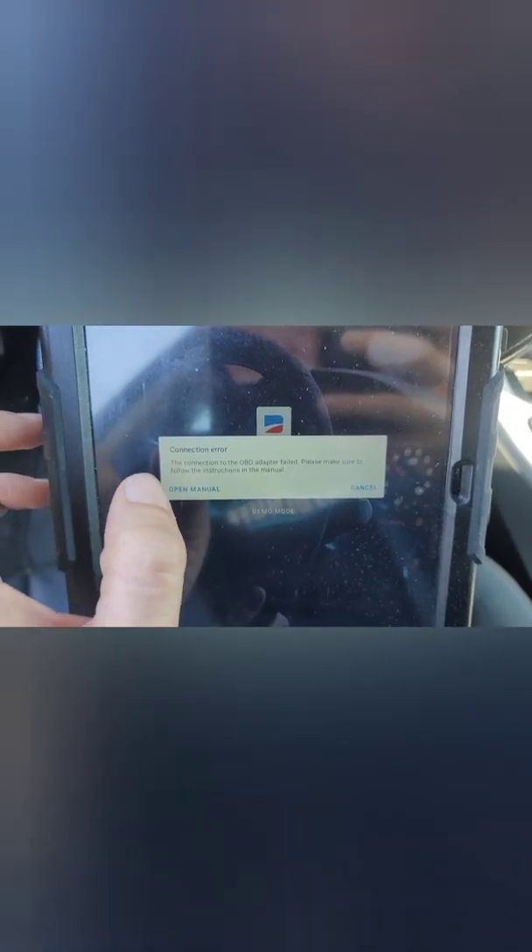Close the center if there's too much reflection. All right, got a 12-volt battery. Go down here and it's going to say 'register new battery.' It's saying I got to use the Bimmer Code app. So I just finished updating the app. Now it's connecting to the car.